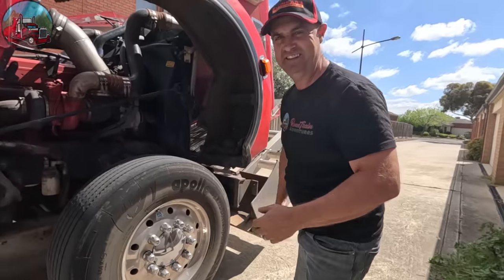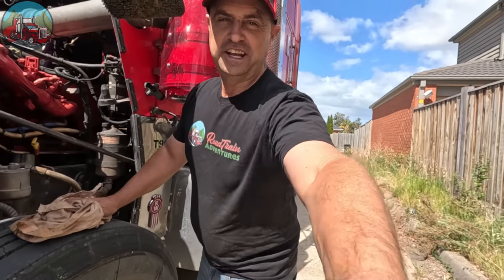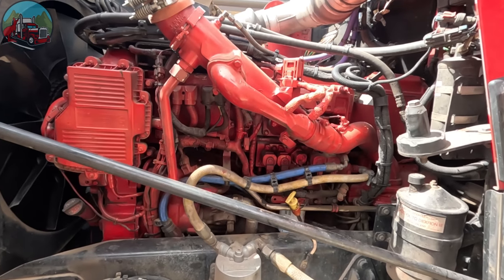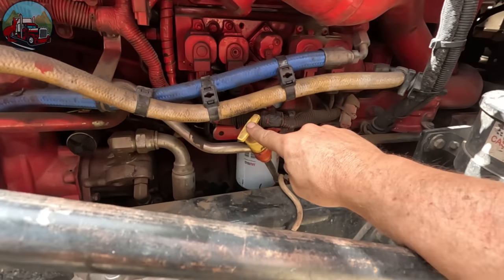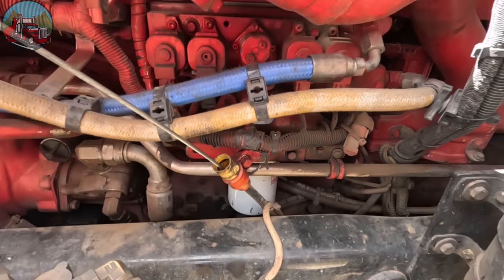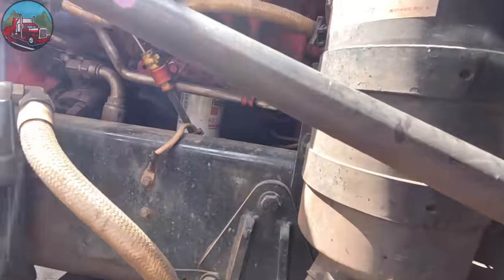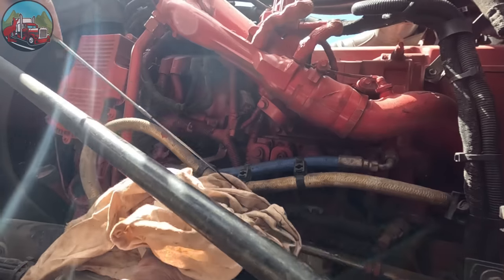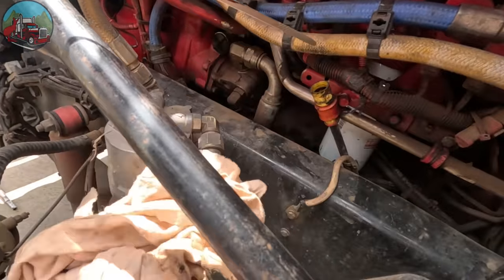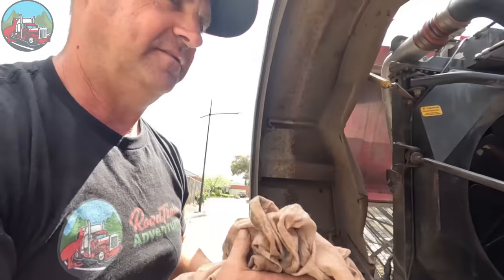Okay, what are we going to look for first? Come around here, David. So here we have the engine — the red thing is the engine in the bonnet, yes. Anyway, here is the dipstick and we're going to be checking that. Simply turn it a little and pull it out. We pull this out, get the rag ready, and we can see it's just a little bit more than about half. That's fine — the engine was serviced some time ago so that's a fine amount of oil.